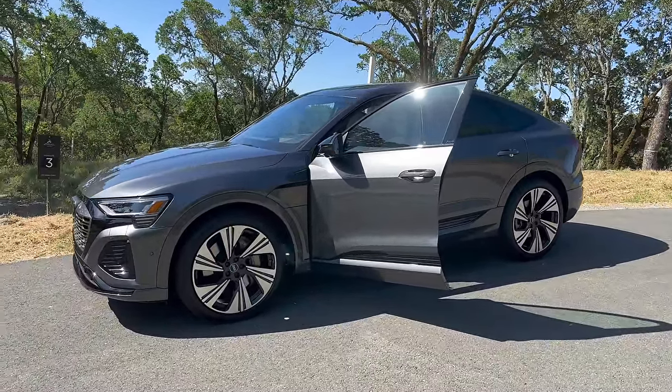And from a comfort perspective, when I lock the suspension in normal comfort mode, which is how we drive our car most of the time and how I imagine most e-tron owners drive their cars most of the time, I'm noticing a couple things. The first is, in terms of smoothing out the small bumps, probably equal. This one has 1-inch larger wheels. We have 21s on our car. This one's on 22s. But I'm also noticing just ways that the suspension behaves differently. So there's quite a bit more body porpoising over bumps. The e-tron's always had a loose back end.